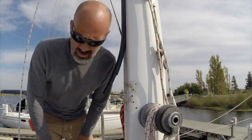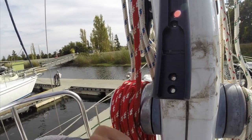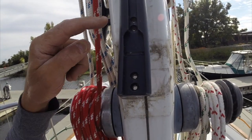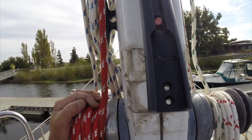I think I'm just about there. Grab a pair of binoculars and check to make sure I'm at the masthead. You don't want to cut off this end if it's too long — you always measure a little bit long. What you want to do now is pull the whole thing out, figure out how far I am down to the gooseneck plate — right there, that dirty mark on the mast — pull it all back down and cut that off the top.